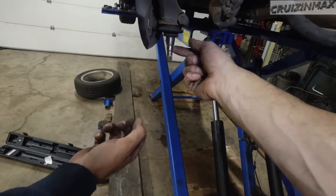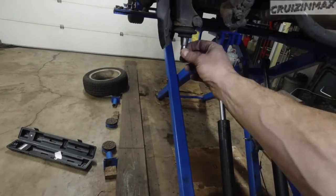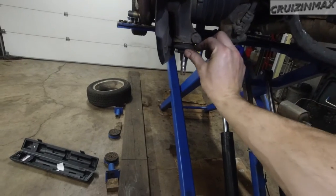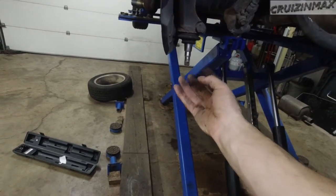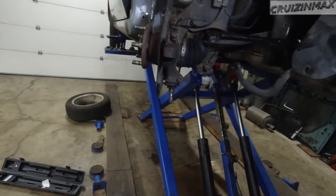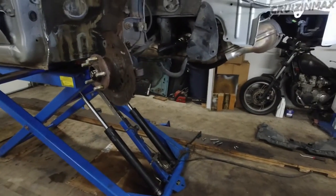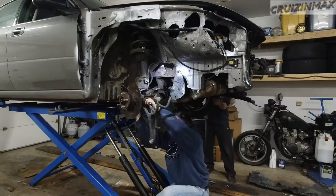And then the control arm is going to go on, and another washer from the bottom, to hold it in place so the control arm doesn't damage the rubber or the ball joint. We can make it tight so it doesn't move, just to get it out of the garage and then back in. Obviously, we're going to have to wait a few days for the parts to come in. So that's that. I'll show you the result. Subframe needs to come off.